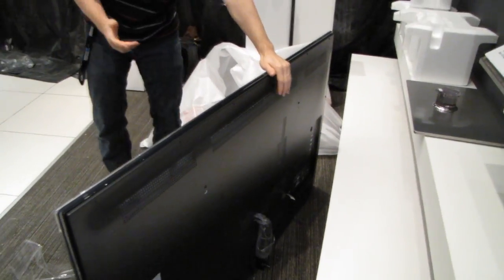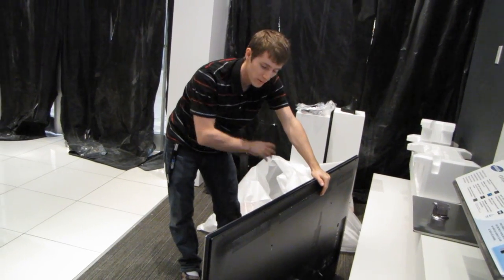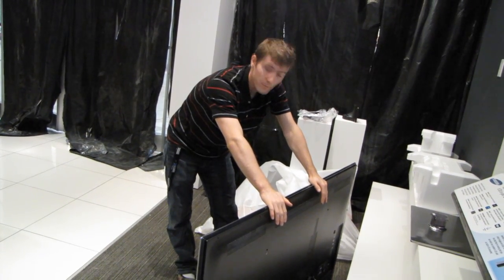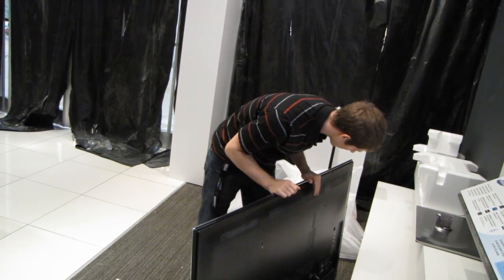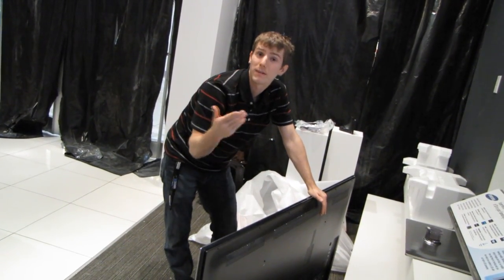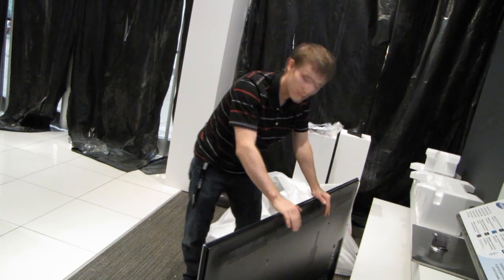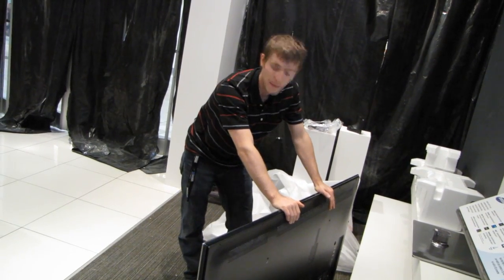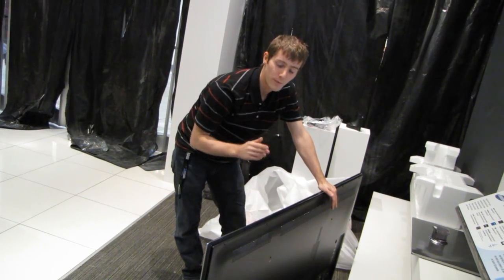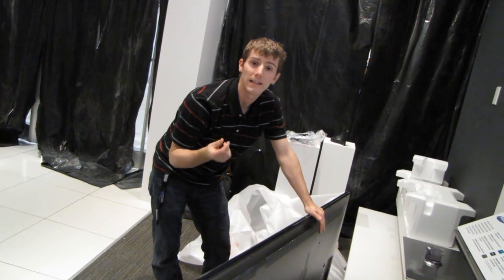So, advantages and disadvantages of plasma. The advantage is the very responsive screen compared to your typical large format LCD. Another advantage is cost. Plasma panels tend to be less expensive than equivalent LCD or LED panels. Quite slim due to the technology involved. So typically with cathode backlit LCDs you need a little bit more space behind. Plasmas and LED backlit LCDs don't have that disadvantage. However, with plasmas, there is also the risk of a slightly less satisfying image quality in a less than completely dark room.